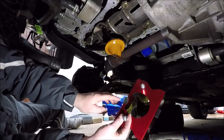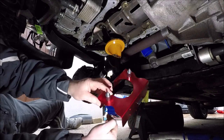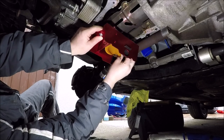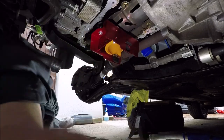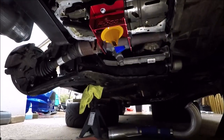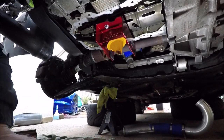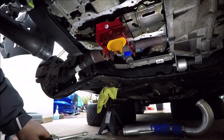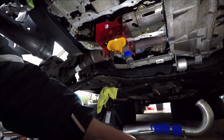There's only one way this will go - the notch out here has obviously got to go over the pipe. Just like that, put it in place - couldn't be simpler. I don't have the exact torque settings for these bolts, but judging by the bolt going into alloy I'm going to assume around about 15 to 20 Newton metres, so that's what I'm going to torque this to.